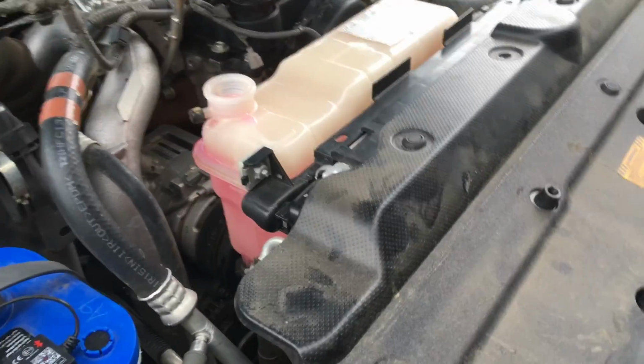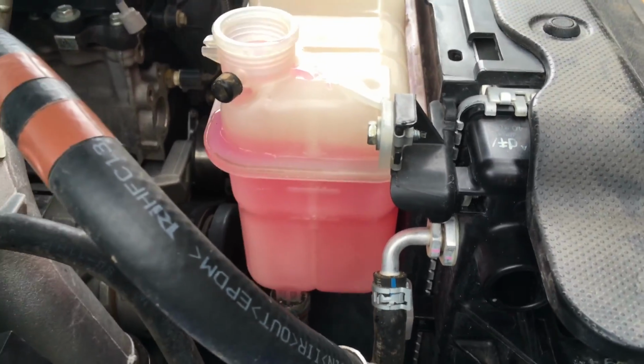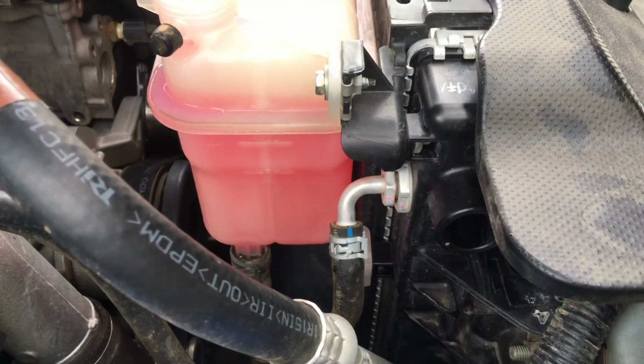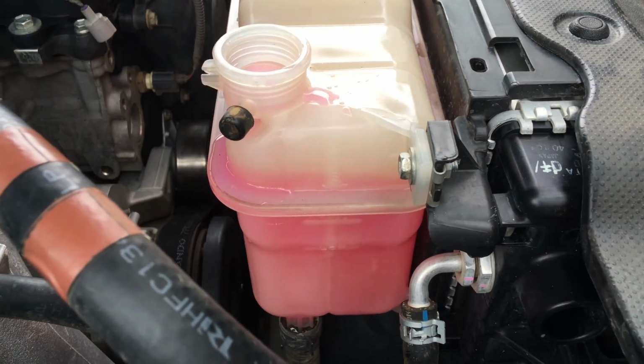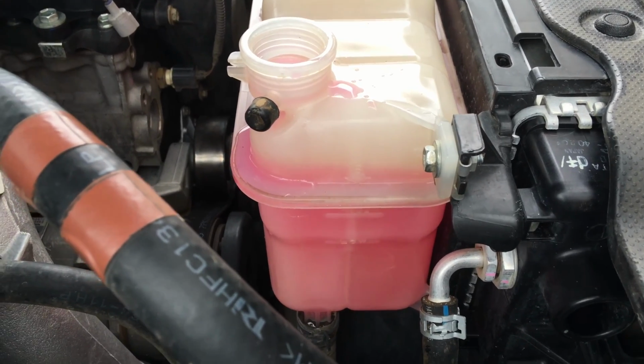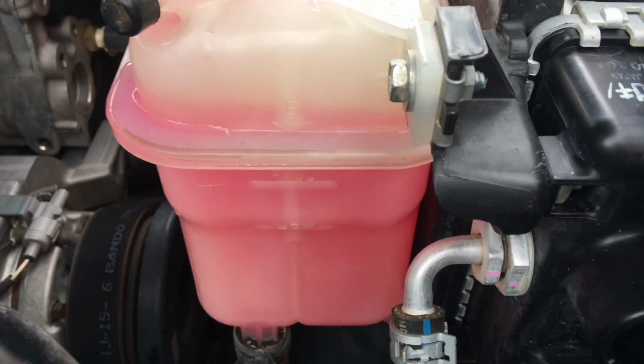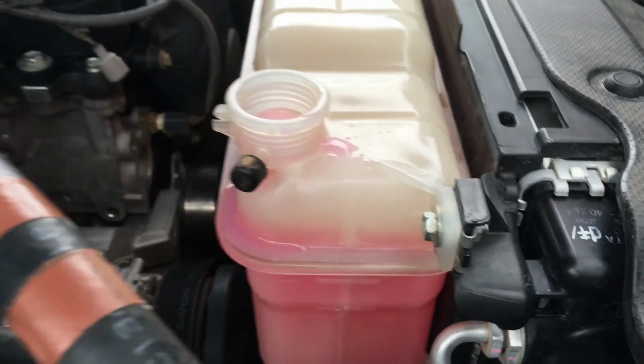Okay guys, so this Prado's pretty well nearly back together. I like to, as soon as the hoses are on and the plugs in, start pouring the coolant in, well before the engine starts. I want it to take around the 7 to 8 litres before we even start the engine. That's around about where it's at. It's sitting just at that level there nicely.